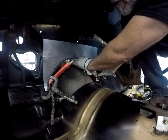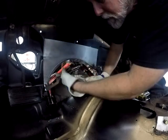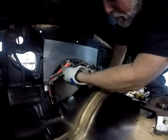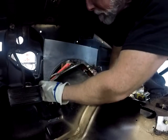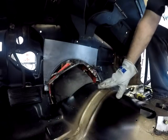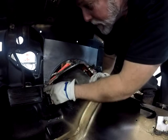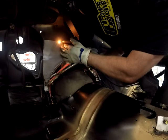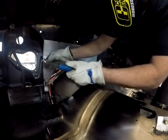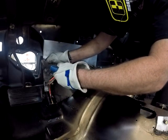So I had to take like a pie shape out of it, which I didn't actually. I just cut it with a pair of shears, overlapped them, and welded both sides up. And it was fine. It was very minimal overlap. The relief was very small. So we're clamping things in, and I decided to tack this in place, which was a mistake. Don't do that.